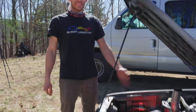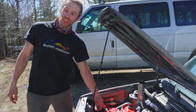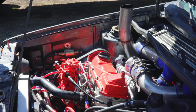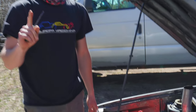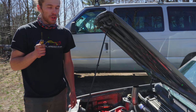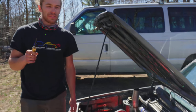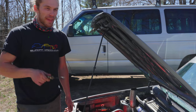Alright, now it's on. So as I said, here's the throttle — watch. I'm going to turn the fuel screw now. You're going to notice two things: one, the RPMs are going to increase because I'm adding fuel, and then hopefully two, we're going to get to a point when I blip the throttle that it just doesn't come back — or at least not too bad, because I want it to come back eventually. And then we're going to go back a little bit from there.